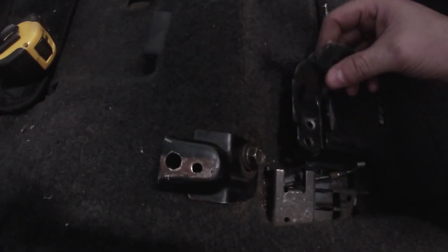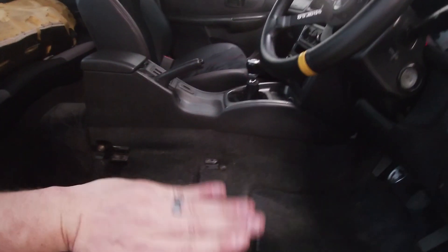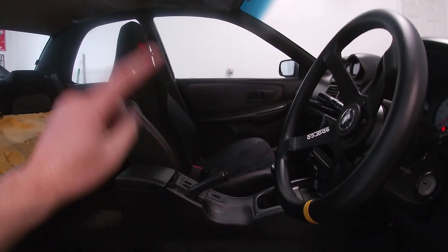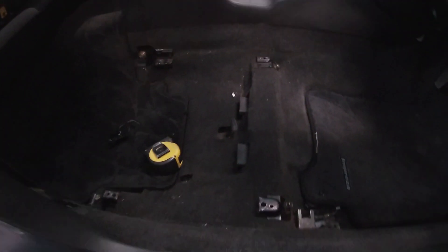A little bit of configuring to do, but that's okay. The old bracket is about two and a half inches — we'll probably do about the same for the front. What we'll do is tack the fronts up first, figure out where we want the tilt to be because there's no lumbar tilt on these seats — or at least on this one since it's the passenger seat. These seats are from a left-hand drive car, so the driver's side has all the adjustment. So we'll get the fronts cut, bring them in, mark where we're going to do a relief cut to bend them, then tack on the rails and see where we're at.